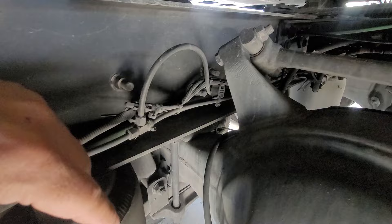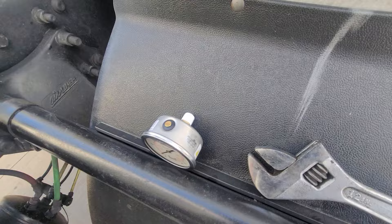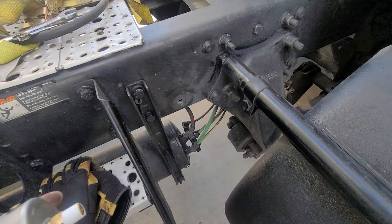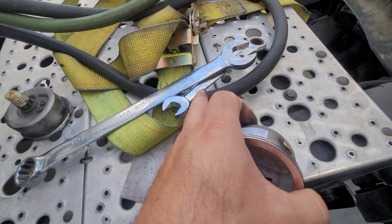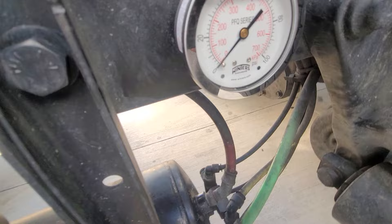Then you just run it to wherever you want to put the gauge. Right now my airbags are down so I'm going to go ahead and install the gauge. I'm getting loaded so I have it ready already — they have some Teflon tape. This nut right here is going to take a 14 millimeter and the one inside is a seven-eighths. I already installed it — as you can see right now it's on zero since my airbags are down.